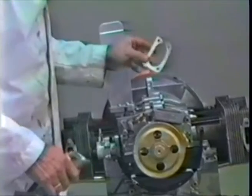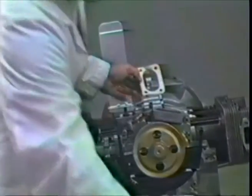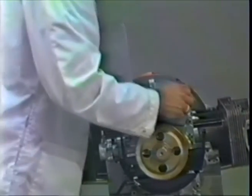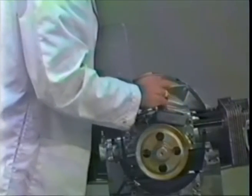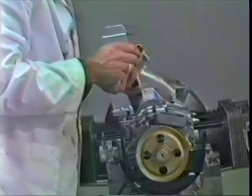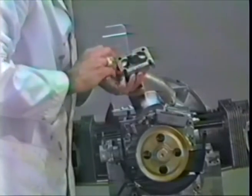You get out the generator stand gasket, the oval-shaped gasket like that, from the lower end gasket kit. Get out your mucilage, put a thin layer. Oh, and incidentally, you should clean off the excess mucilage off the fuel pump. We'll clean up both the fuel pump excess and the generator stand excess after we put on the generator stand. So also coat the bottom of the generator stand with the Ford water pump sealer, like that.